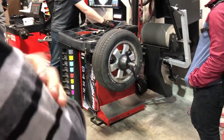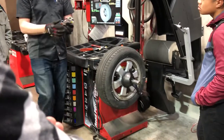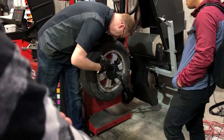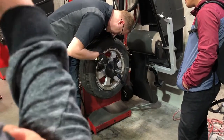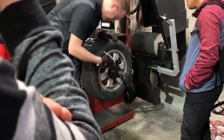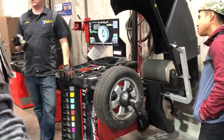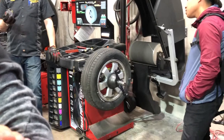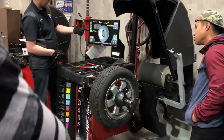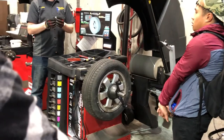So now I need to find the correct wheel weight to go on here — I've got all kinds. This reference guide has all the different shapes of rims so I can match it if needed. Looks like my orange is the right one. Over here it says FN — that's the wheel weight that fits best. It doesn't mean you can't use others; I do it all the time. But if you need to match it, that's what we're going to do. I need 0.75 ounces, so let me find one of those.